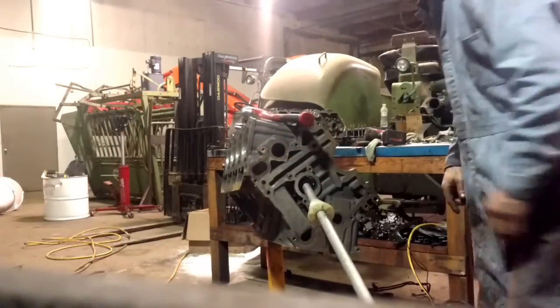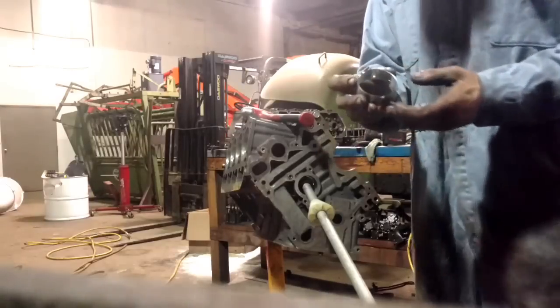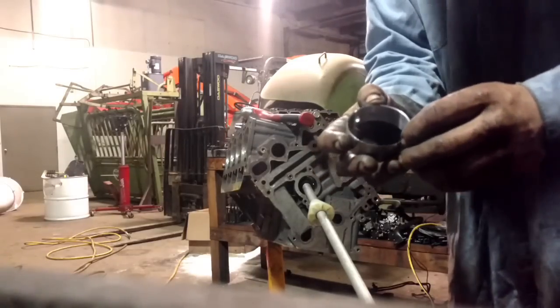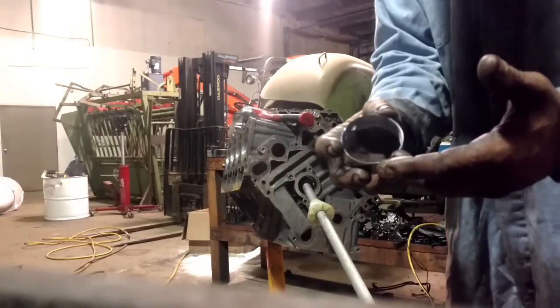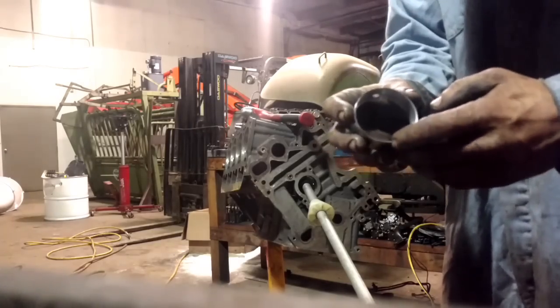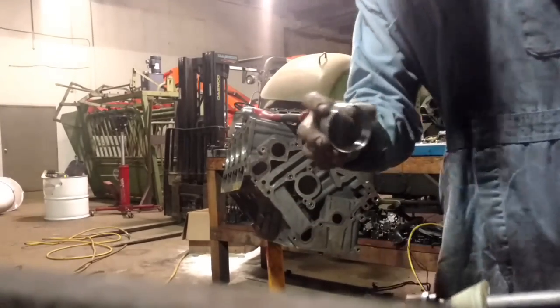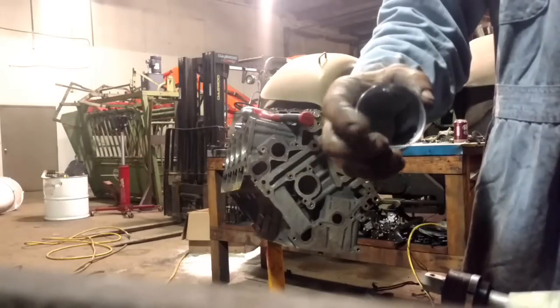Remember, the front bearing is wider than the back bearing. Here's where you put the wide one at the front. These cam bearings have little notches — I'm not quite sure what they're for, but I think they're directional marks indicating which side to put them in from and what side's the front. I just paid attention to the way they came out — this notch was at the front. I'm pretty sure that's what it's for because the oil hole is offset in the bearing, it's not centered. So that notch tells you that's at the front.